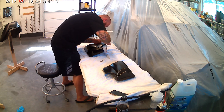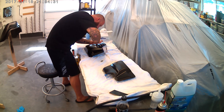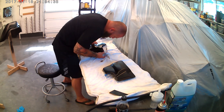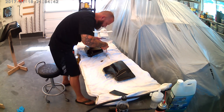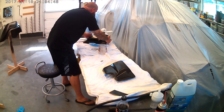What I like to do is paint the color of the stripe the night before in the evening, and then get back out in the shop early in the morning the next day, not crazy early, and then start laying down the fine line. You can put the tape down sooner if you like, but I like having that extra 8 to 10 hours of dry time before I put that down. I've never had any problem with that. It seems to work out pretty well for me, and I haven't had any lifting or anything like that. I think that overnight curing process works good.